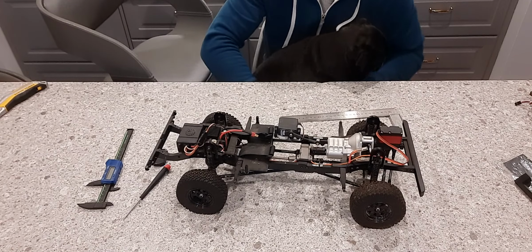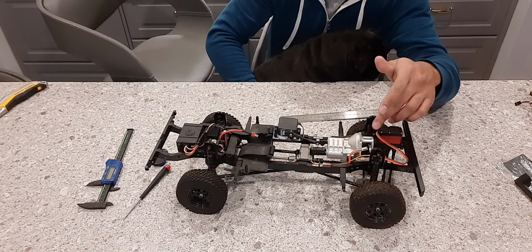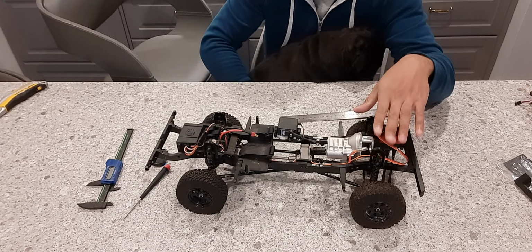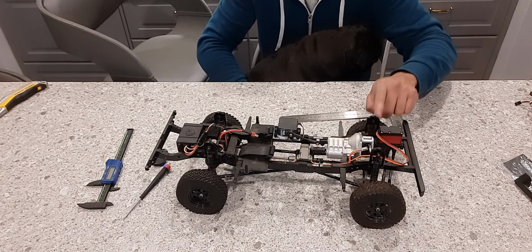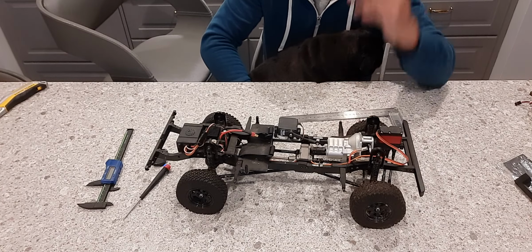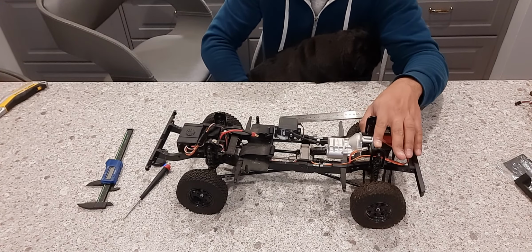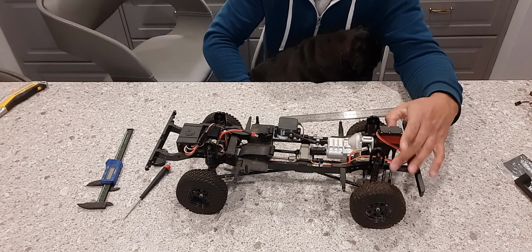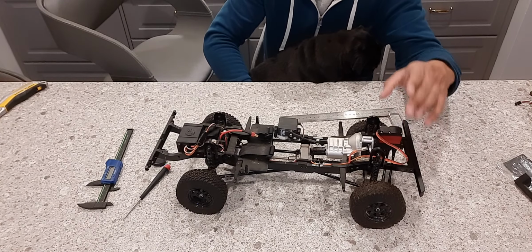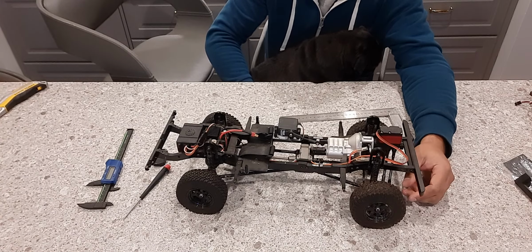Also, another quality of this architecture is that the transmission not only sits fairly low, but it keeps the motor lower than the shock towers. So the things to look at will be the shock towers there, but your motor will be essentially only, not even 2 inches, 1.5 inches over the highest point of the railing, which is really good. That way your motor won't be sticking out of your hood. So that's always a good point.